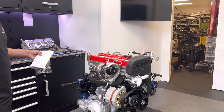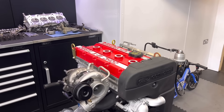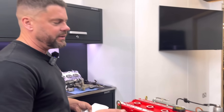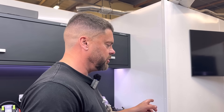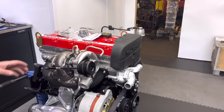The Cosworth — so this is the four wheel drive one. Complete. Looks hell of a good that, look nice. Got the original Cosworth red there for the rocker cover, very nice. We've had that blasted by ADH — thank you very much. Our blasters obviously use a fine glass bead, so if it's fairly thick paint it doesn't touch it. It ain't worth us messing about — you can do it but it takes forever, it'll take you most of the day. So we've got him to blast that one and the other cover for the other engine. So I've got to post him the cover. We're faced over the top of it after painting it red, put our little sticker on there which looks very trick, and this thing is done.